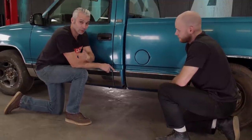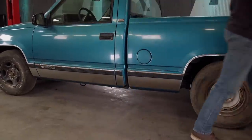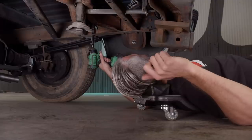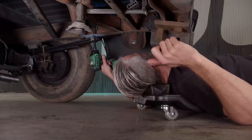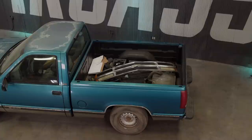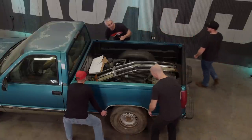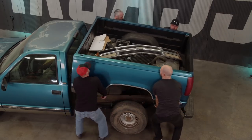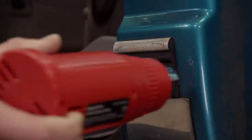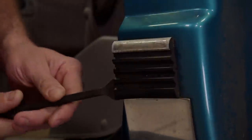With the cost of these repair panels, it really doesn't make sense to try to fix the hole — we're just going to replace the entire cab corner. The easiest way to get to that cab corner is to get rid of the box first. If you don't have a cherry picker handy to get the bed off, just ask a couple friends — it's easy to take off. We'll use a heat gun to apply a little bit of heat to the molding and then use a scraper to peel it right off.